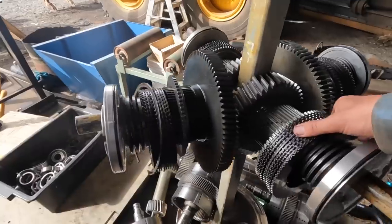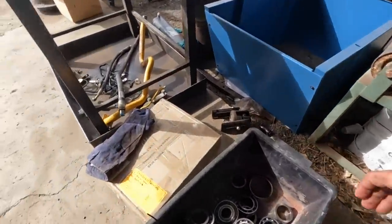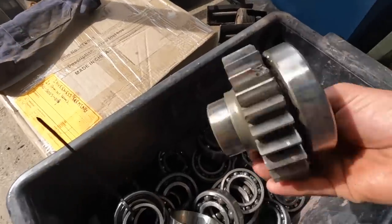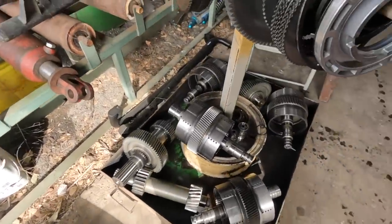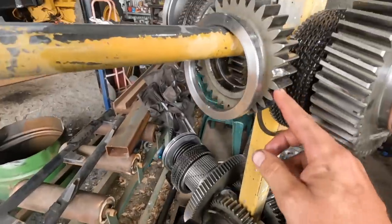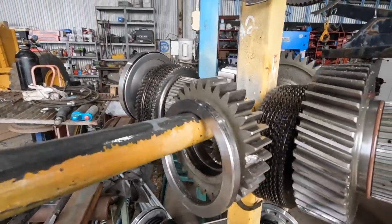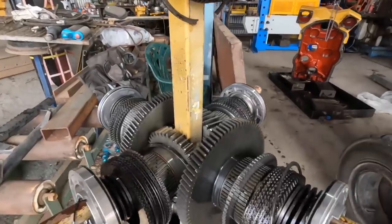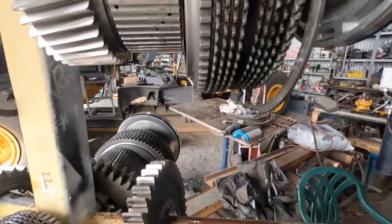Oh yeah, and all we found, thankfully, other than two bad gears, which we suspected with the bearing failure, that one there, and the other one's here somewhere, but anyway. Oh, this one here, yeah, she's hanging up. So they're the two dud gears. And then out of all the clutch packs, it was just this up here, wasn't it? This one was the dead one, yeah.